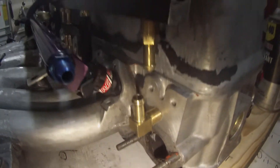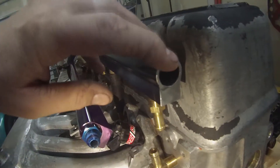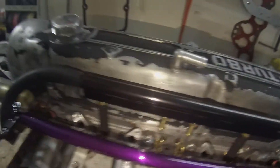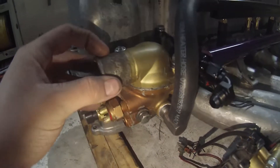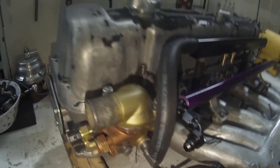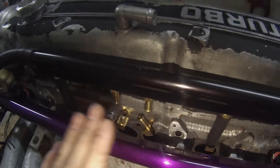I have the fittings drilled here on the head and I've made this rail system. It has an 11/16-inch bore and it's all three-eighths lines down here, and then it goes into a five-eighths hose into the bottom of the thermostat. I didn't want to bypass the thermostat because that's going to cause issues with heating and the car warming up, so I just wanted to keep it somewhat streetable. I also have the intake manifold on here and the fuel rail to check for clearance.